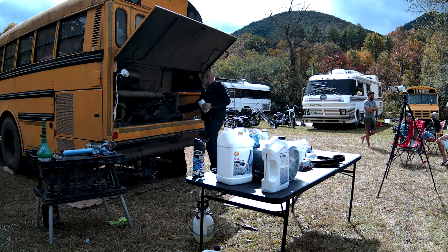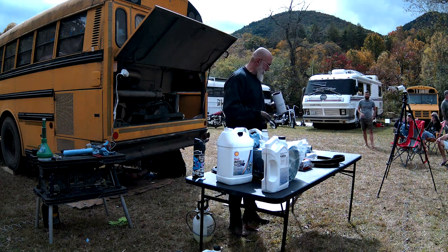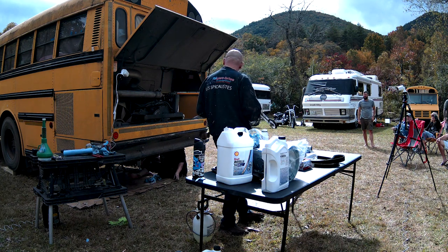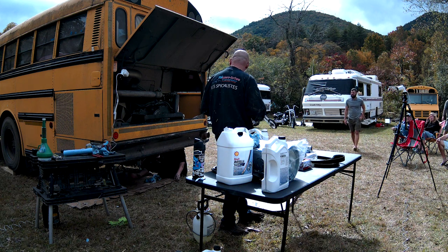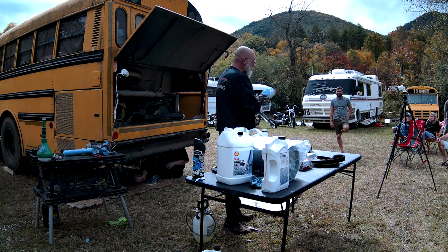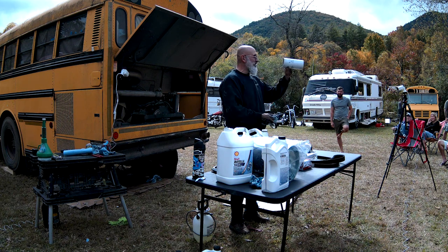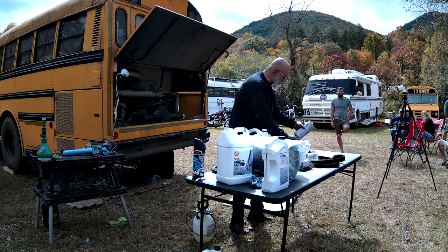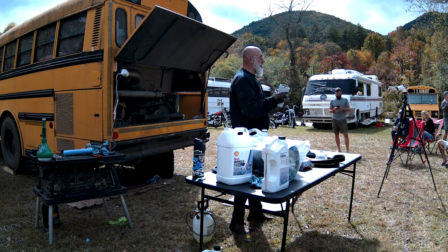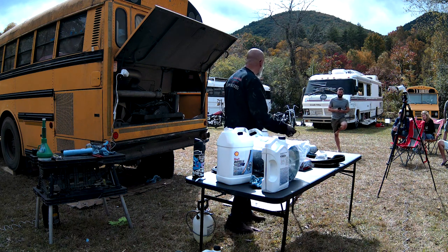It looked like it was primary. And the filter she got for her secondary is not the right filter. It's missing a part. Are you talking about the bowl? Yeah, you don't have a bowl on your old one. But that's the one that's easy to change? Yeah. So if you look at this filter, we have the top end that we normally have, but you can see through it. No bowl. There's normally a bowl that goes on here that resembles this. It will have this little fitting on it to separate water out of it. There's not one. Someone changed her filter at some point in its life to one that would fit the space, but not the right one for the bus. Do they both have a water separator on? Yeah.